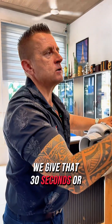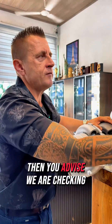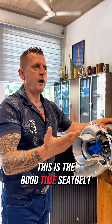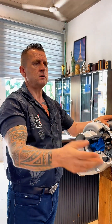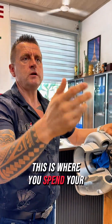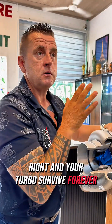What happens? Trouble — it heats up and sometimes the shaft turns blue. This is why we give 30 seconds or one minute. By the book it's two minutes, but who has two minutes? So what you do: start your car, put on your seatbelt, check your phone, answer a message, put it down, adjust your mirrors — you are good to go. That's your 30 seconds to one minute, and your turbo will survive forever if you do that.